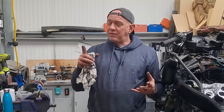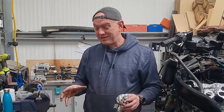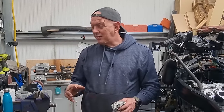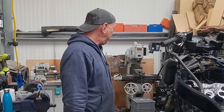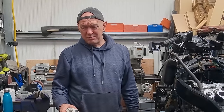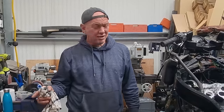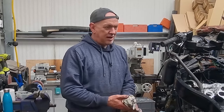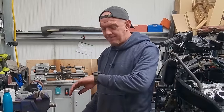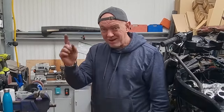This week Friday through Monday is a bank holiday so I'm going to be in here all day Friday trying to get stuff done, because Jamie's in on Saturday and I do want to get it running. Not bothered about the airbox - it'll run without that. But we've still got quite a lot to do: oil cooler needs to go on, valve gaps need sorting, carbs need to be rebuilt and stuck on, exhaust needs to go on. I've got my work cut out but I do want to get this thing going.